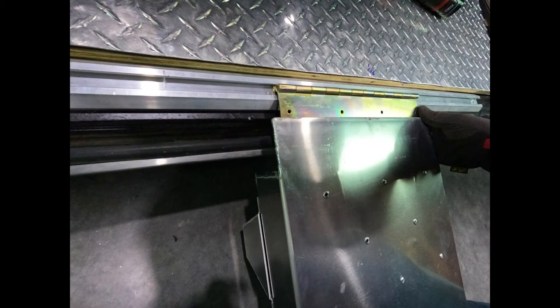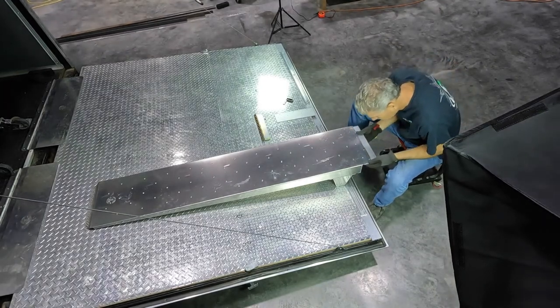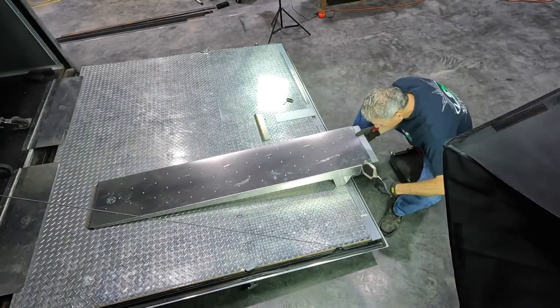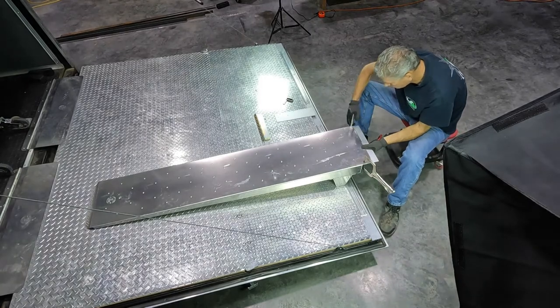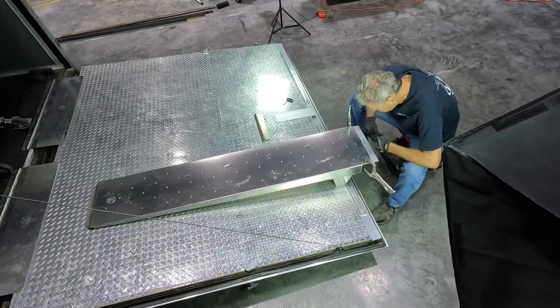Mocking up the ramps with the tracks actually secured in place, I tested clearances and fitment with the ramps stowed on top of the door as they would be when putting them away, and found that the track is now too low — the hinge is trying to pull out of the track, so I need to raise the track slightly. The answer was to install a quarter inch thick, two and a half inch wide piece of aluminum flat bar on the rear of the door, and you can see the tracks bolted back on top of that flat bar. And there are the plates I made — four inch by 13 and a half inch — that's what's going to fill that gap to get our ramps back where they don't hit our door.